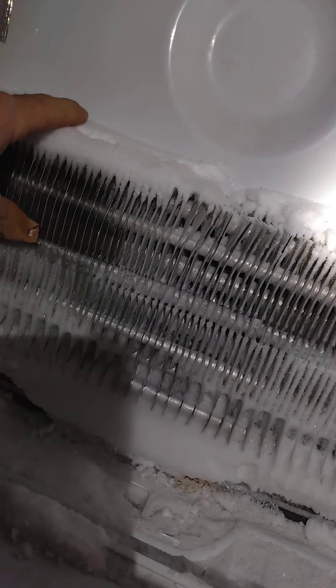This is what it looks like when I pull the cover off. This ice is also going down into the freezer hole here. This is where the air goes down into the refrigerator right there. It's blocked, so there's no cooling going on as it's supposed to be.